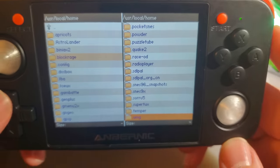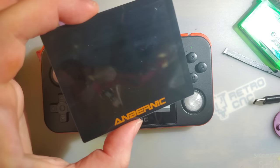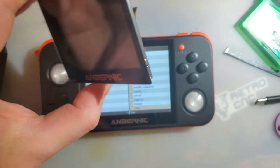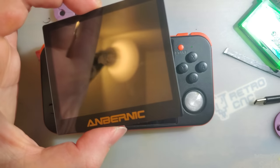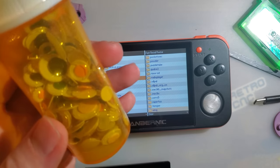Look at how clean that looks. Okay. I could go on and on about the nice screen all night, but I'm not going to. So I am going to wrap it up here. I've got the old screen. I did actually clean it up. I'm not a monster. I didn't clean the outside because there's no point in cleaning the outside. But I cleaned up the inside of the lens and then the front of the LCD and then just stuck it onto the old lens like it's laminated. And if for any reason I ever accidentally break this, I can drop this in again. I'll have to switch my firmware back, but it's doable. Also, did I mention it's laminated, so it's right up against the glass, and it looks so much better. Okay. Anyway, I'm done. Sorry. Drop my Google eyes.